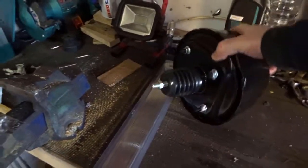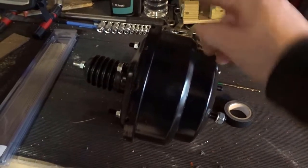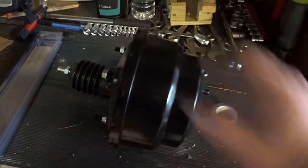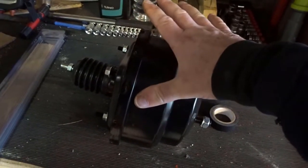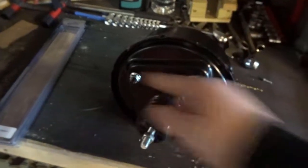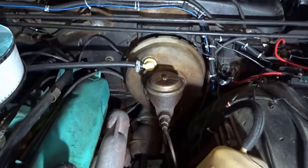I've done an awful lot of searching around and what I've got is this. There are variations on this available — they're all pretty similar. It's an 8-inch dual-diaphragm, not single, booster. That means instead of it being like a wide dinner plate, it's about 8 inches in diameter, which is actually deeper than the old one, but its diameter is the same or actually maybe slightly less.